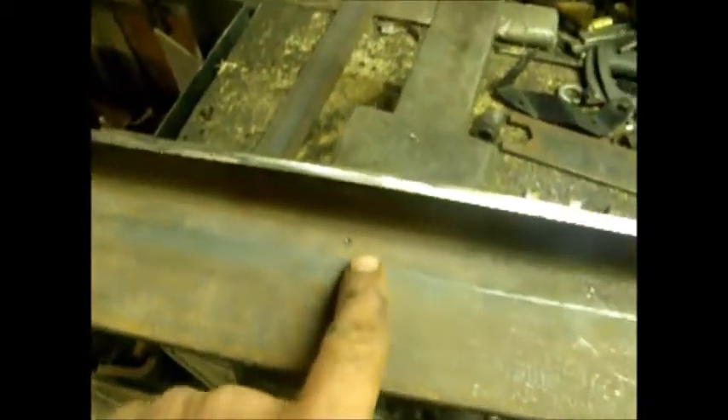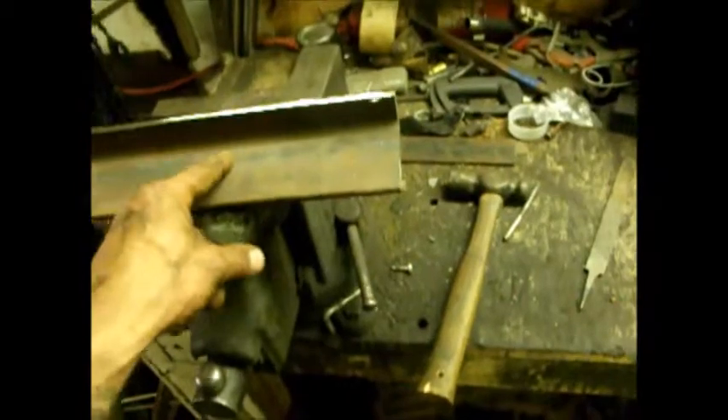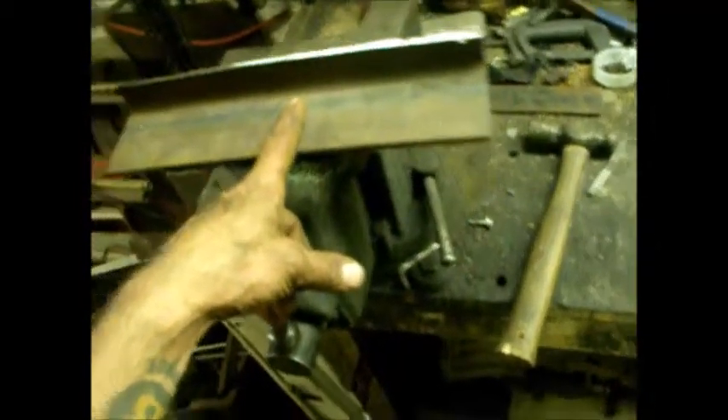What I've got here is this piece of angle iron — a three-inch angle. I marked it along the back side of the hitch, and it's going to go on the back side of the hitch up against the frame and then weld along. I went up a little further because the crossmember kind of V's. I'm going to put 7/16ths holes in it — probably use either 3/8ths or 7/16ths bolts, grade 8, whatever I've got room for on that crossmember because I think the crossmember might be a little narrow to put 7/16ths in and leave any meat.